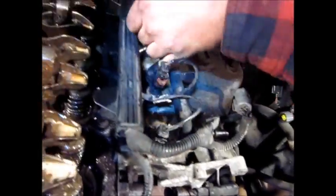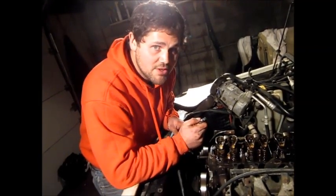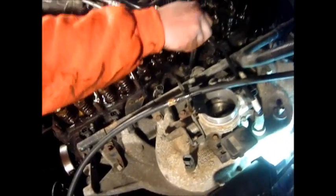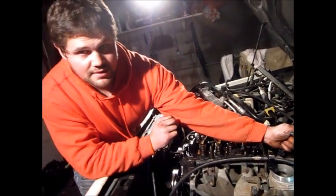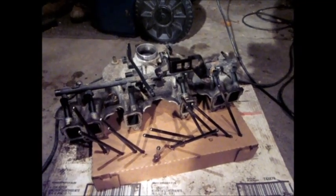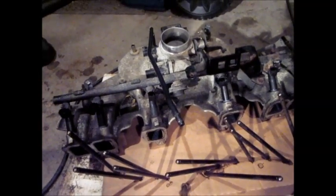The helper is unplugging all the fuel injectors. We're pulling the upper intake and exhaust manifold bolts off — we soaked them in oil and luckily they're all coming off without breaking any. This is where ratcheting end wrenches come into play, because you can't really get a regular ratchet and socket in there. After removing all those bolts we managed to get the intake off.